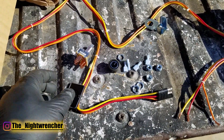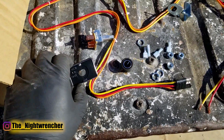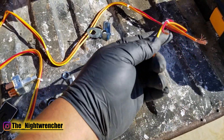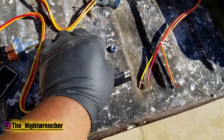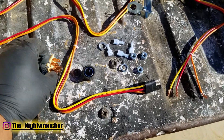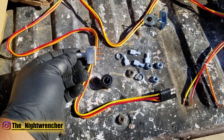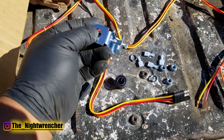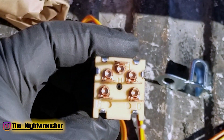For the wiring we've got a three-position switch — low, medium, and high — plus a knob, faceplate, and the wiring harness itself with three wires for each speed. The motor grounds at the motor itself, so there's no ground wire on the harness. It came with spade connectors and some nuts — the nuts set the spacing for your dash. I have an aluminum overlay plate on my dash, so the extra thread length really helps. The back of the switch is clearly labeled: low on the left, medium in the middle, high on the right, and a 'B' terminal for battery power.